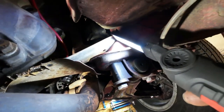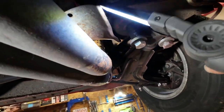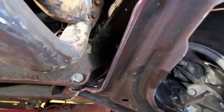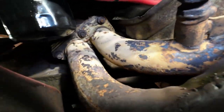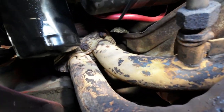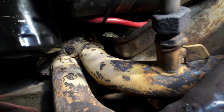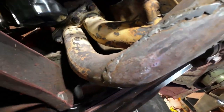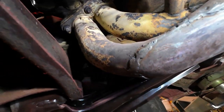Most of the screws are missing, as usual. I don't know what's holding it at the top — I can see a nut holding it up there. The easiest thing might be just to drop the exhaust pipe out of the way. Surprisingly enough, all the nuts on the exhaust manifold up there — there's two there and one at the front. The front one was tough to get off, I had to put heat to that, but the others just cracked off with a bit of penetrating oil.